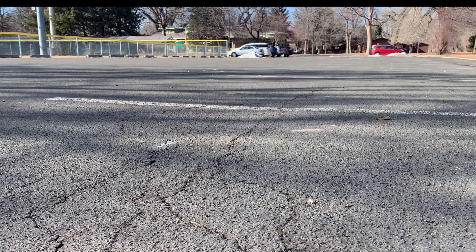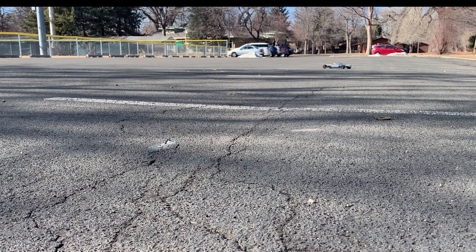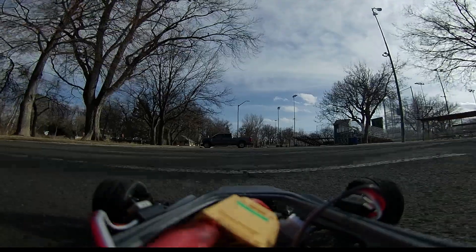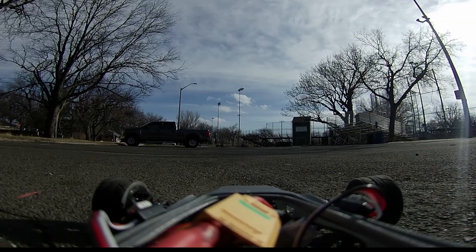It does need torque vectoring very badly. The only issue I found was that the parking lot I was using had some tiny magnetic stones that would get pulled into the motors and lock the entire motor up. So I need to design some sort of guard that still allows for airflow around the motor but blocks those stones from coming in as easily. I did learn there are a couple of areas on the monocoque I do want to strengthen. It's probably complete overkill, but honestly I might try to thin the monocoque out and go from a 0.8mm shell down to a 0.4mm shell. As I've started some test prints with all of the aero devices, this car has gotten much larger and heavier than I wanted, so I'd like to cut as much weight as possible.